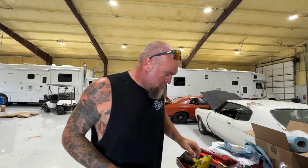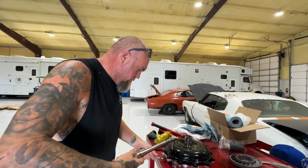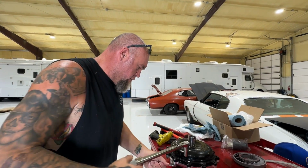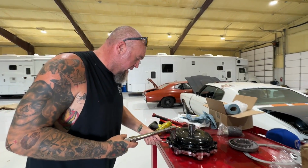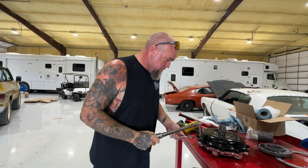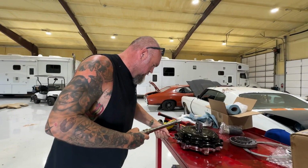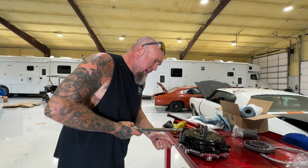We've got 26 passes on the MH7. 2 passes on the bearings because we did change the bearings after our second test pass in, wherever we were, New Hampshire, because the secondary injector shut off about 250, 300 foot and smashed some of the bearings. Most of them look good, but it was starting to smash. A couple of them were smashed. And you can tell fairly simple whenever you're changing the rods. You pull the rod cap off, and the top rod bearing slides around and will fall off. Because all those explosions going on inside the combustion chamber are literally trying to send that rod down through the crankshaft. So the top one is the one that gets beat up the most. So other than that, the couple of smashed ones, it didn't look that bad.